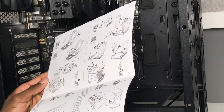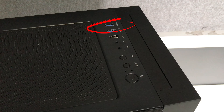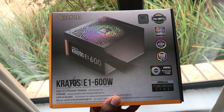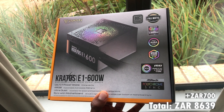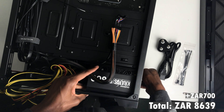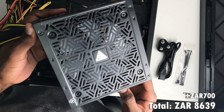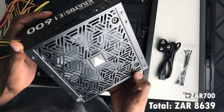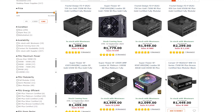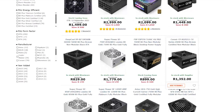In my experience you usually have more screws than you need, as some come in the motherboard box, some with the power supply, and you can also use leftover ones from the CPU cooler box. Once the motherboard is in the case, you're about 70% done with the build. Next I connected the case I/O to the motherboard — make use of your motherboard manual here as it differs by board type. Try not to force any connections; I ended up damaging my USB 3.0 port, so now those two front USB ports on the case are not going to work.